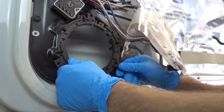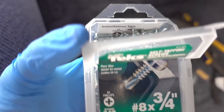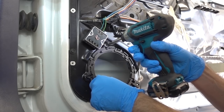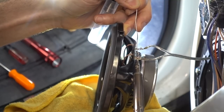My system came with a speaker bracket, and I decided to use it. Line that bracket up on the door — these trucks have little dimples where screws can go. I bought self-tapping, self-drilling screws from Home Depot for under $3. Line up your bracket, make sure you have the correct tabs cut off, screw it in, then look for the spots on the bracket where you'll screw the speaker in. You may need to drill through the metal for a cleaner path so the screws don't wander. It's pretty self-explanatory putting the woofer into the door — put the bracket on and put the speaker onto the bracket. For wiring the woofer, I chose to solder it on. I tried little electrical connectors first but couldn't get them to fit properly, so I soldered the wire on.